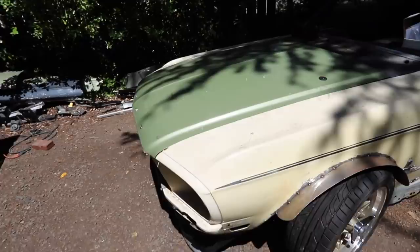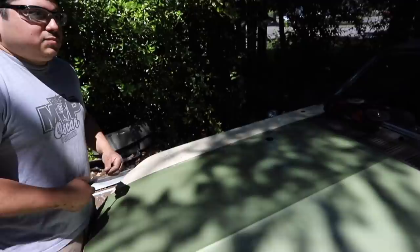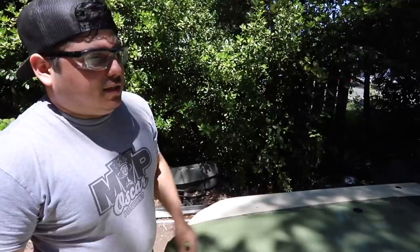Oscar, do you wanna describe what you're gonna do here? Yeah, I'm gonna go with a dimple die idea, and just put some big dimple dies basically in the middle of the hood. So we're gonna cut a strip out of there, a strip out of that side, build some aluminum plates with dimple dies in them, and then rivet the plates into the hood sheet metal. Yep. It's gonna look awesome. I'm excited for this.